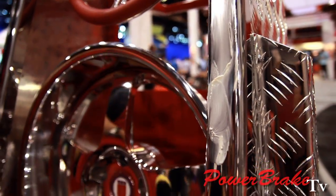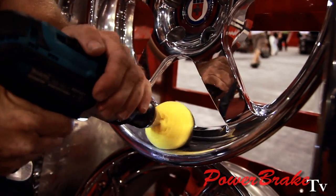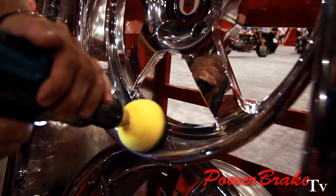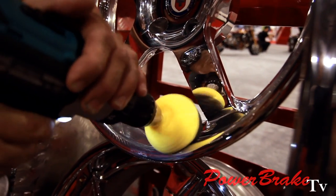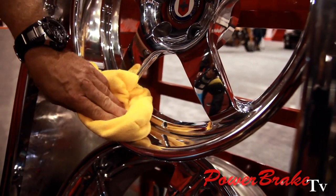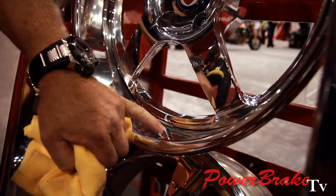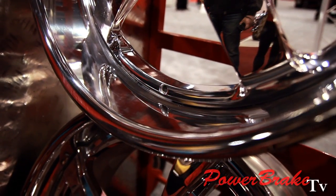Take this at medium speed — you don't have to use high speed or a lot of pressure. Polish it out, work it nice and easy back and forth. Take your microfiber towel, take one wipe, and it wipes off the majority of it. It'll polish back to a shine, but it's still going to leave a little haziness and roughness because this is a rough cutting polish.